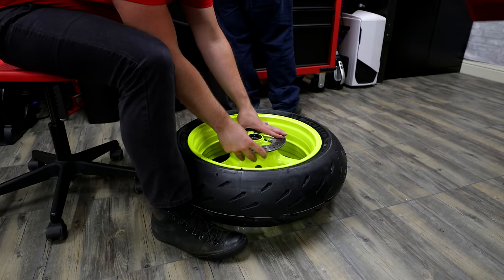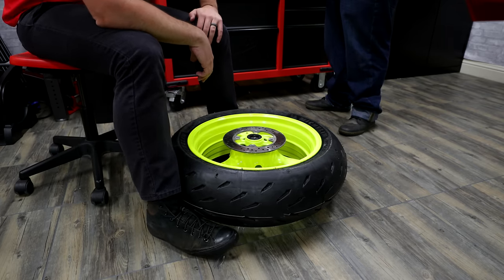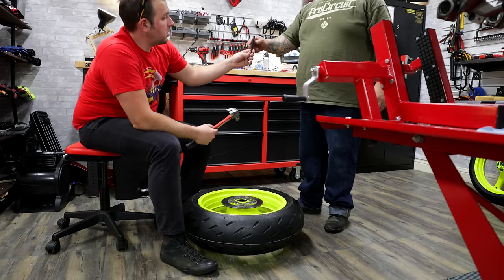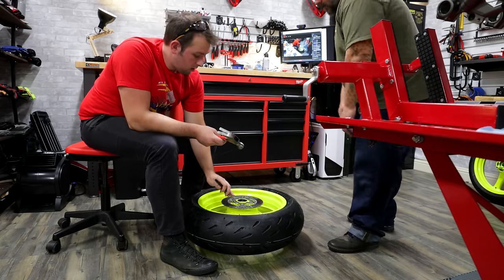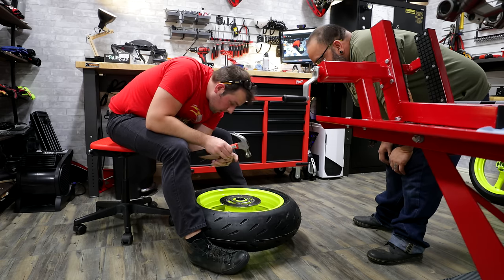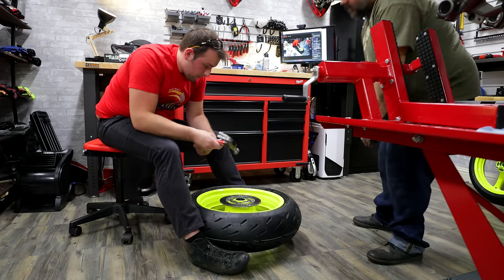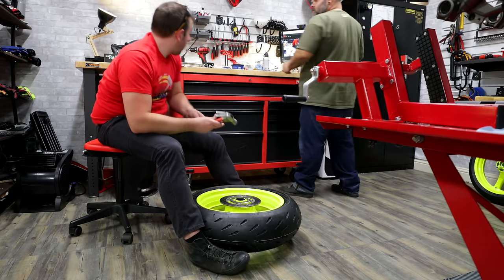Oh, it fits on. Oh, that's a little ABS wheel speed pickup ring. Should I tap them here? Right at the very edge where it's gonna go past the powder on the wheel. And this side should touch the metal, right? Just see what it does. Okay. And make sure all those bolt holes are lined up, because once you get that thing on there, it ain't gonna turn. Okay, it looks good. This thing ain't going nowhere.